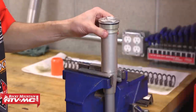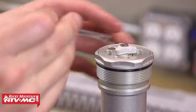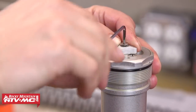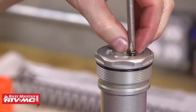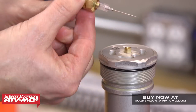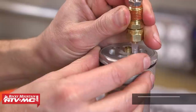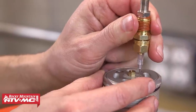Now we'll take our inner cartridge and gently clamp it into the vise. From here we're going to remove the inner cap from the outer one using our tusk fork cap compression removal tool. First we need to remove the compression adjuster using our 2.5mm allen wrench, and once that's out of the way we're also going to remove the access screw to the inner bladder — that's the screw located closer to the center of the cap — using a Phillips screwdriver. You'll also find a small o-ring underneath that screw that you'll want to keep with the screw. Next we're going to take the Racetech shock nitrogen needle and use this to bleed the air out of the inner bladder. Pierce the bladder through the center of that access hole and you'll hear the pressure release once you've made it all the way through. After letting all the pressure out of the inner bladder, remove the needle and put the cap back on it.